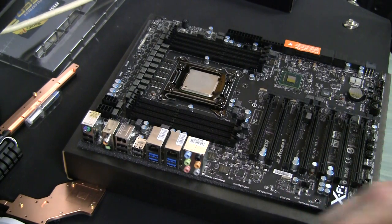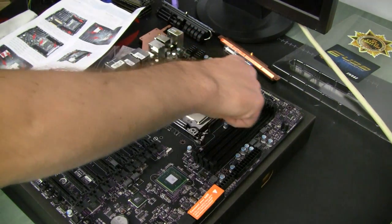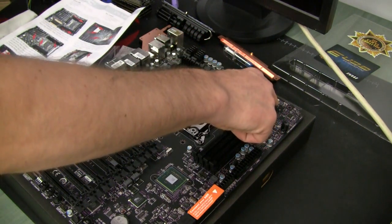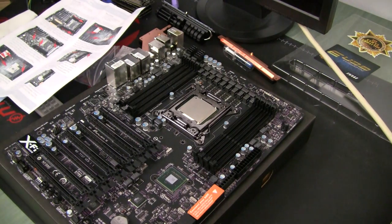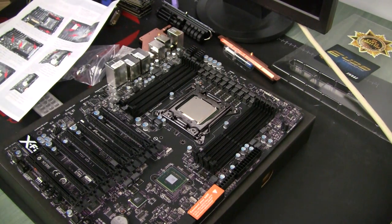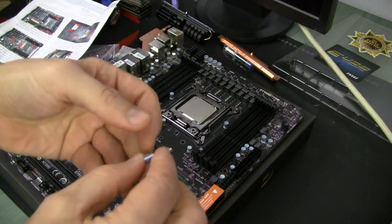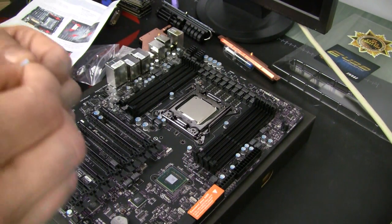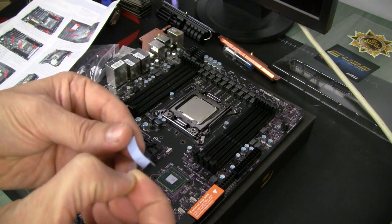That's pretty easy under normal conditions - it took some effort, but in my case the board is barely in contact so it's easy to do. According to the instructions, I need to put one long thermal pad on those chips, a little thermal pad on those two, and put thermal paste on the microchip - that's what I'm going to do now. Do not forget to remove the protective film from the pad - there's film typically on both sides.